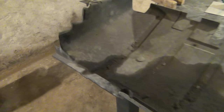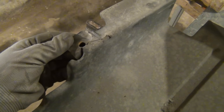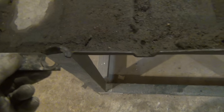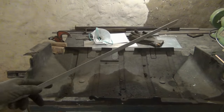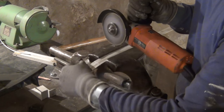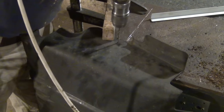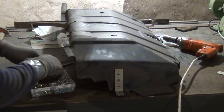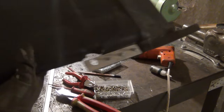No more rattling, at least for now. The next thing I had to take care of is the plastic cover with all the broken parts. Here in the basement, this is how I fixed that issue: I took some stock aluminium and bent it into shape, cut it, drilled a few holes, drilled also a few holes into the plastic cover itself, and then bolted those angled aluminium pieces to the cover. I also used some Loctite to fasten the nuts so that they wouldn't come off while driving. I implemented a solution like this for all four holes that used to hold the cover under the car.